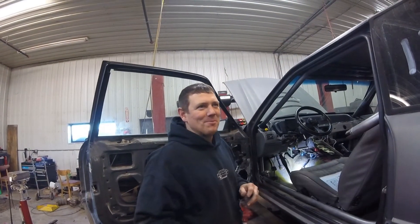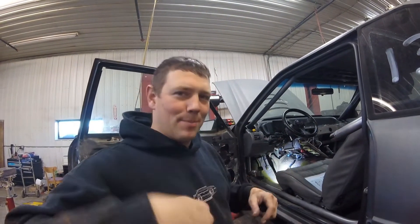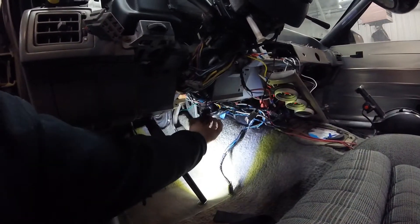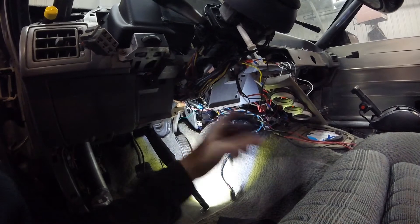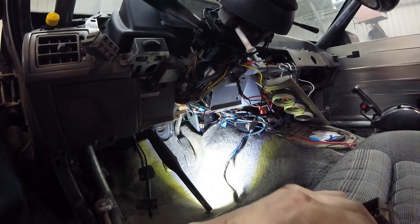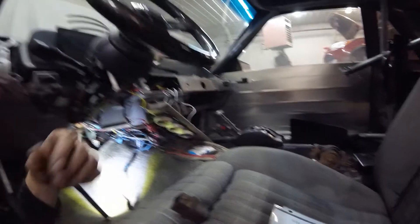Shane had a good idea. Instead of using this typical switch for a bump box - which'll get wrapped around stuff unless you've got it hanging everywhere - we're going to use the horn on the steering wheel. We're not using the horn as it is, so there's a factory relay right into the dash for it. What we're going to do is re-pin this connector. There's a connector under the dash here for the horn that goes to a factory relay, but it's a specialty one. The connections are spade connectors and they'll fit right under this relay. We're just going to take it out of that connector, tie it into this relay - boom, bump box done. We'll just run the wires over to our bump box itself. It's going to be a hell of a lot easier than I thought.